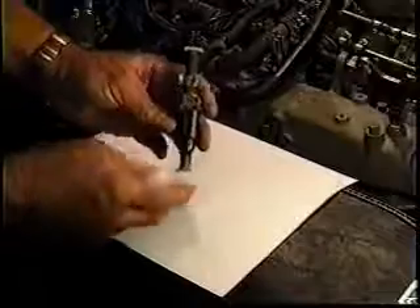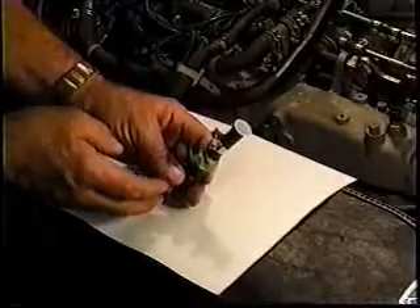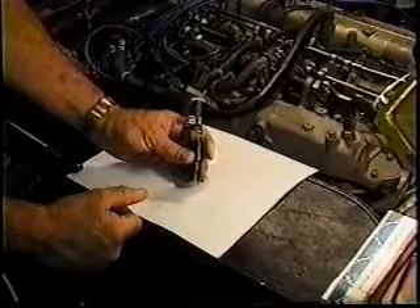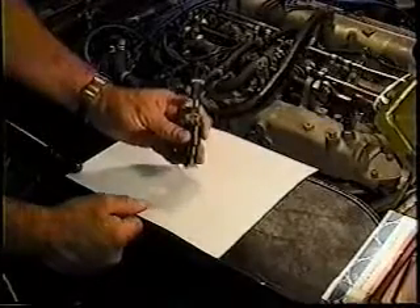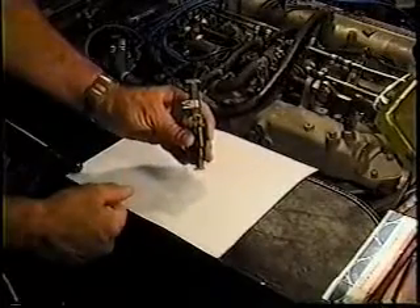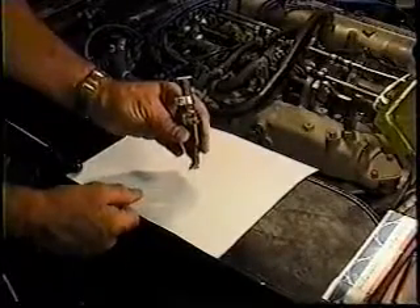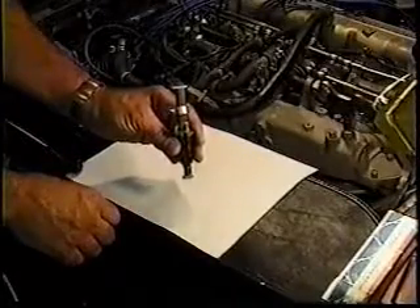Where the connectors go together here, I think it's a design flaw, because as the connectors sit in the chassis, this forms a little bathtub, and if water gets down in here, it wants to begin to corrode these contacts on the injector. Water — either exterior or interior in this system — is the biggest enemy the system can see, short of electronic meltdown. I don't recommend trying to clean them with a scraper or scratcher because you will damage them and they'll just oxidize worse. The best thing is to blow them out with air and replace the connector.